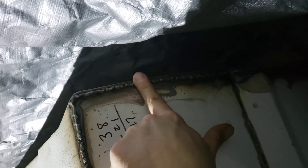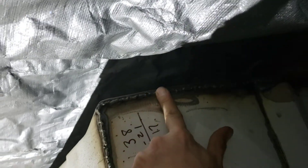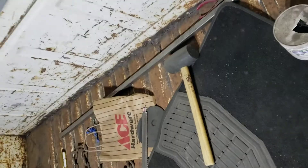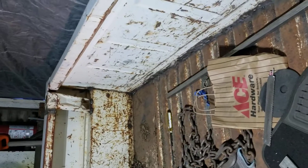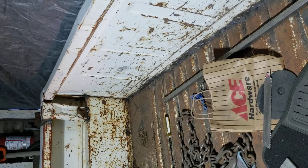On the white truck's bed, getting everything shortened down before I cut the center section out. Did this one a bit different — cut the bed up here off of the front half, not around the pocket, then came back and cut it so that when we weld it, it's right here on the edge of the bed. That way when it gets ground down and body work is done, it'll be a lot easier. Then slid the head of the bed forward and got it welded on the back side so there's no seam in the middle.